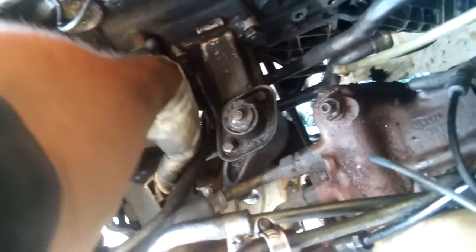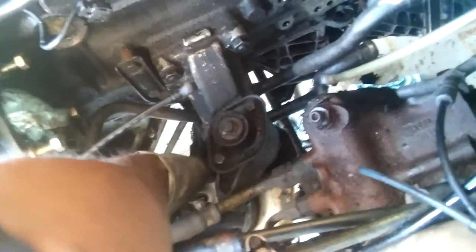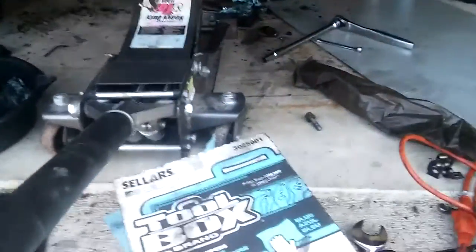I cleaned the area up right there — that's as much as I can clean. Now I'm ready to install and put the new mount in there. The new engine mount goes on. Looks like I have to jack up the engine a little more because it's not clearing the space. Engine mount is positioned. Now I have to install these two bolts first and tighten them.